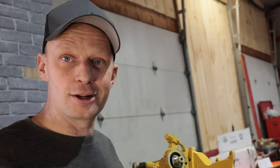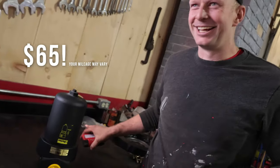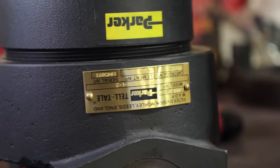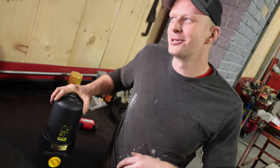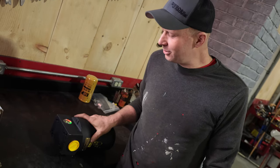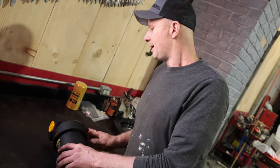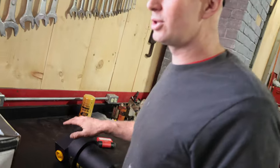Because it took so long and we hopped on eBay, we found this bad boy for $65 — which ended up being just under $200 to the door. This is a 5,000 PSI, 400 bar filter — 400 bar times 14.7 — so this is plenty big. It's got a screen on the inside and will do more than we ever need it to do. The only issue is it weighs 40 pounds. We'll make up for that by maybe putting airbags on top of the springs in the front, moving the fuel filter to the back. It's got a gauge to tell you if your Huey pump is screwed — throw it away if it gets into the red. We went to VNR who had all the fittings we needed, including size 20 O-ring fittings. The only issue was they didn't have that in a 08 JIC for the 4,300 PSI oil line, so I'll machine those in on the lathe, weld that properly, and put this nice and close to the high pressure oil pump just on top of the frame.